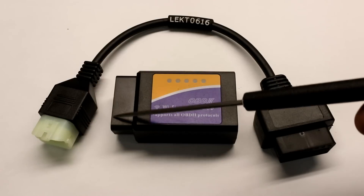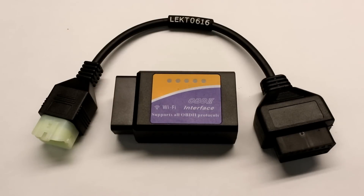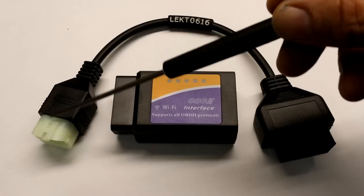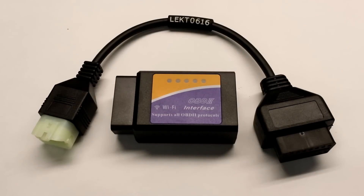The Wi-Fi scanner has an OBD-II 16-pin connector, and you'll find that the KTM TPI bikes have a 6-pin CAN bus connector, so you need a conversion cable. I purchased this conversion cable from a company in the UK called Lonelec for about 15 UK pounds. It converts the OBD-II 16-pin connector to the KTM 6-pin connector. I'll put a link to the cable in the description of the video.